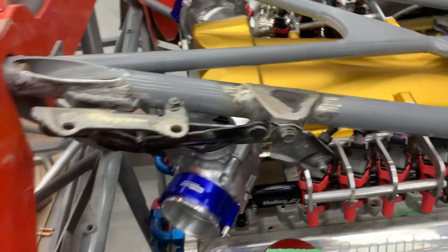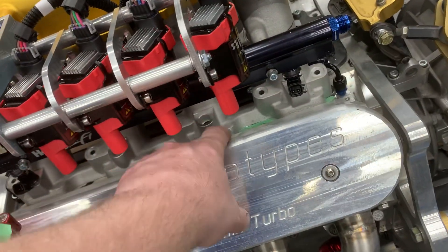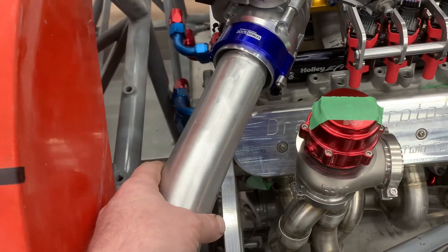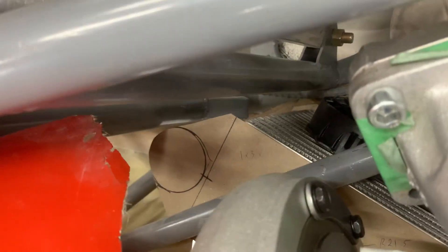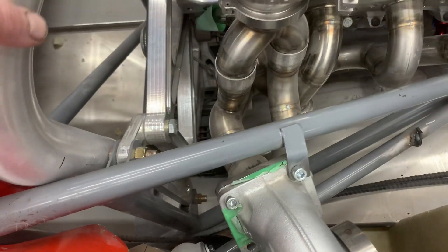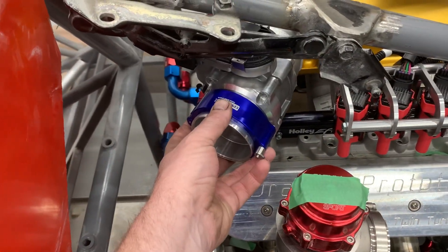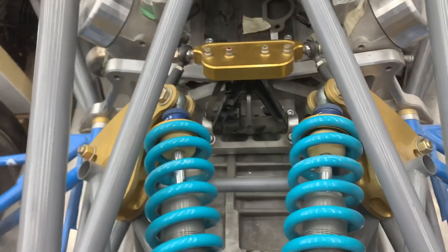There are five o-rings sealing this: two in there, one in there, and two over there. The throttle body to manifold seal is there, and there's a large o-ring underneath to seal to the Holley Hi-Ram, with o-rings from the base of the Holley Hi-Ram as well. So o-rings galore. Now I can confirm the intercooler piping will come up in an S-bend, then to the pipe and into the engine. The road's not too long - a few hard turns so some flow resistance, but I think I've got a big enough turbo. Both sides are done with a lovely symmetry going on.